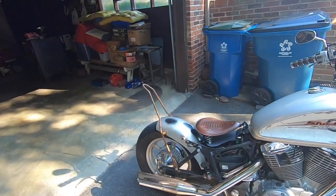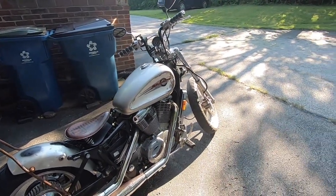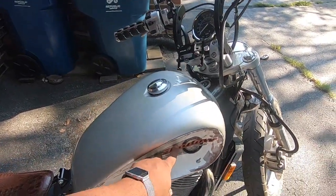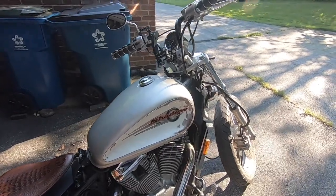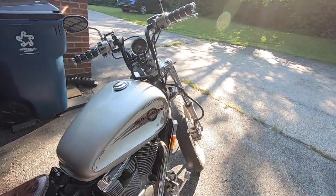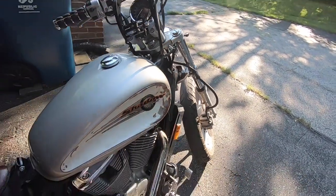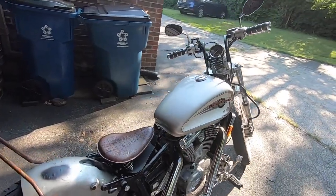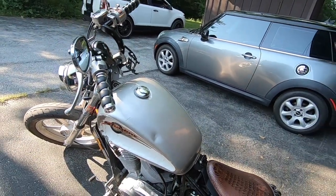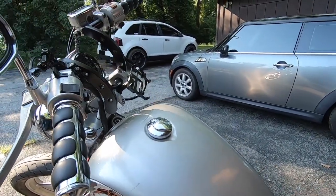Don't mind the paint job because it's going to get repainted soon. The first thing you'll notice is the tank. It was a completely stock tank — you can tell by the logo. It had some dents on it, so I just decided to dish it in. I took a little shaping hammer and dished in the sides so it would give that old-school chopper look. It turned out really nice. This one dent is still here — I'm going to see if the paint guy can get that out. But otherwise, that's what I did to the tank.